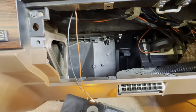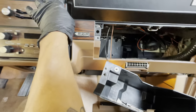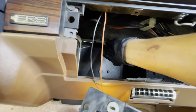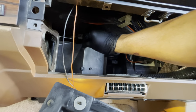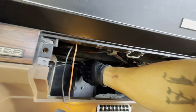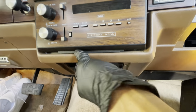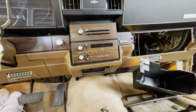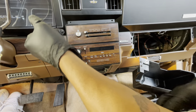That's the temperature cable, so that's this cable. In order to pull this up out of here, that cable — you just need to loosen it. Don't start breaking stuff because stuff is brittle back here, however old your car is, and these parts aren't easy to find. So be careful — take your time, unscrew everything, don't get to yanking and pulling. Once that's a little loose, you can start trying to slide this up out of here. You got a lip right here — you want to get that over that lip and it will start sliding out.